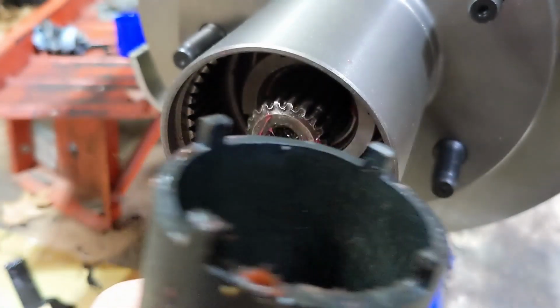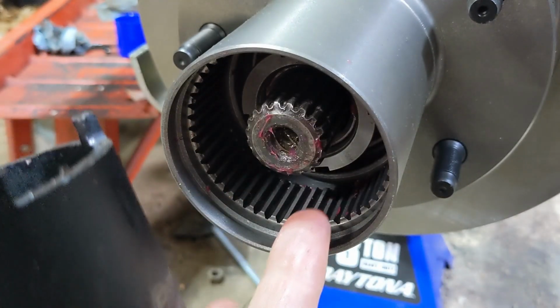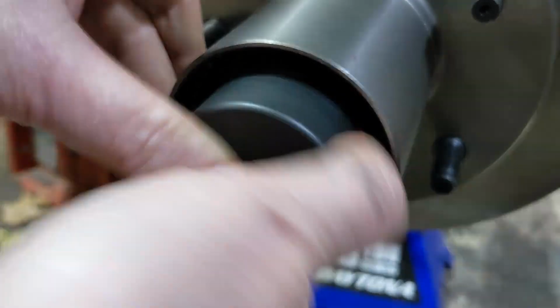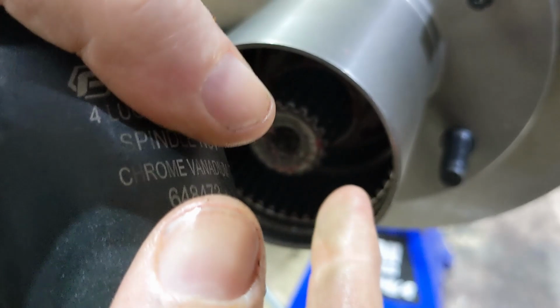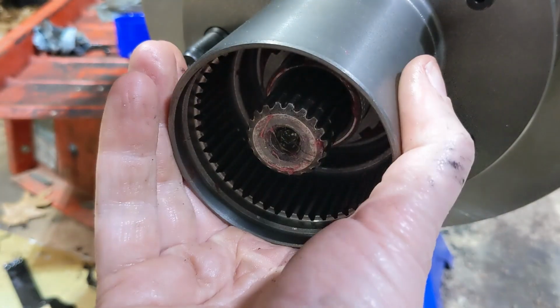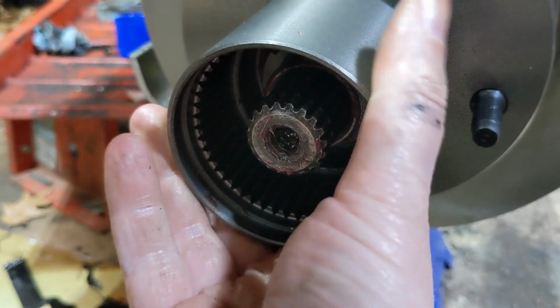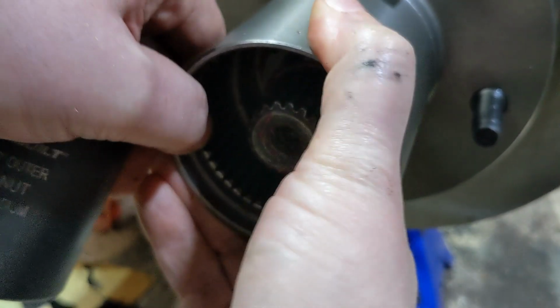And you need one of these 4-point sockets to put it on. You should have one because you needed it to get it off. So now the question is, how tight should this be? You want it so that the spindle has zero play. No up, down, in or out. Kind of reef on it a little bit. Make sure it does not move.